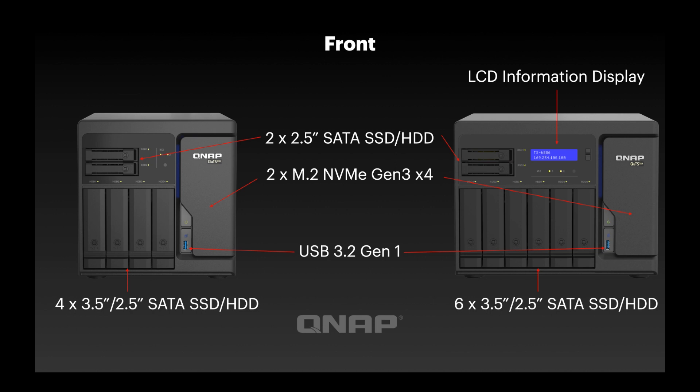At the bottom left, both units have the three-and-a-half-inch and two-and-a-half-inch drive bays — obviously the larger unit has two more. There's no need to use caddies for two-and-a-half-inch drives in those larger bays. We do have extra screw holes marked on the drive trays and we supply all the screws in the box for either size. The drive trays are screwless for larger drives, but if you want to screw them in, that option is still there. Both units also have a single USB 3.2 Gen 1 port on the front for easy quick-connect access.